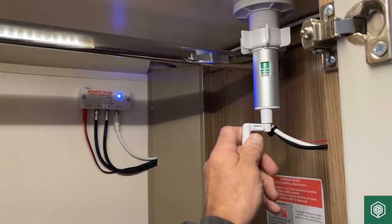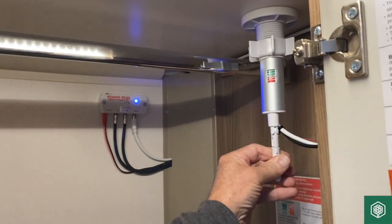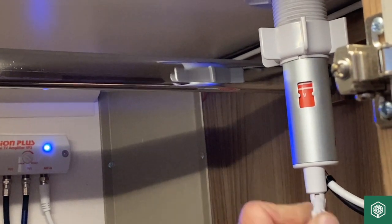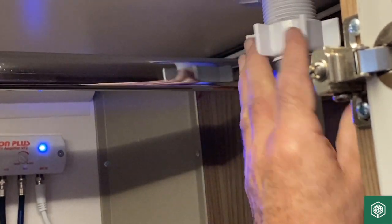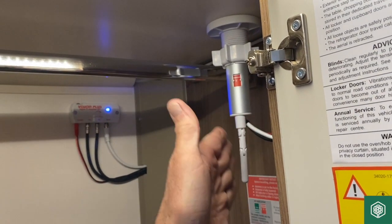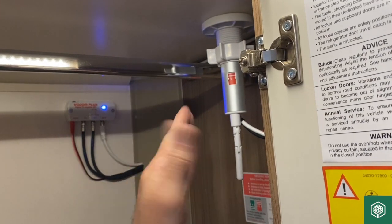You can crank this round to a different location and it changes from a green picture to a red picture — it's now vertical. On stereo systems you can get better reception when the antenna is in a vertical plane. However, be aware that if the aerial is vertical it may hit the roof when you try to retract it.